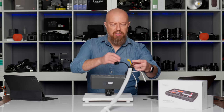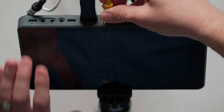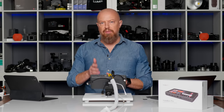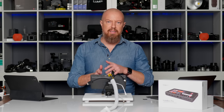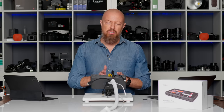I've got it in place. Let's start plugging things in. I'm going to start with an HDMI output — that'll allow me to record the screen. I'm going to plug in the ethernet as well. You don't have to plug in ethernet to start; you can do this all over Wi-Fi. However, I've found it's definitely easier if you can give it an ethernet connection to begin with. If you don't have one, you can still do this over Wi-Fi, but you'll have to find and enter the password for your network. Part of the initial process, which I've already done, is to create an account with YoloBox — you actually need to do that. It's part of how the whole thing is configured and also how you do some of your streaming. If you can give it an ethernet connection to start, it just makes it easier.